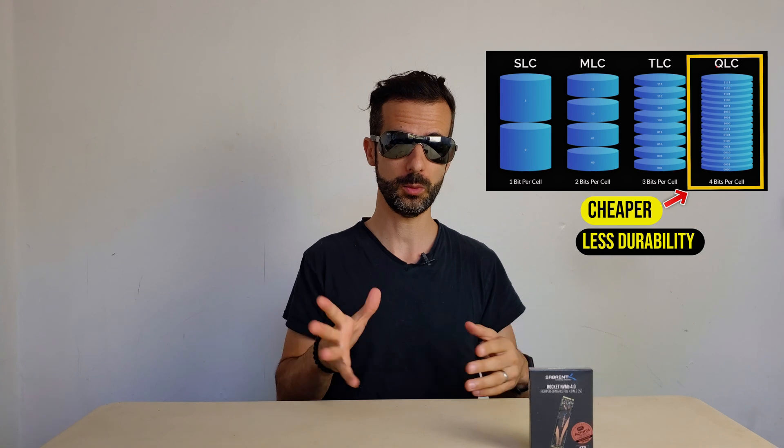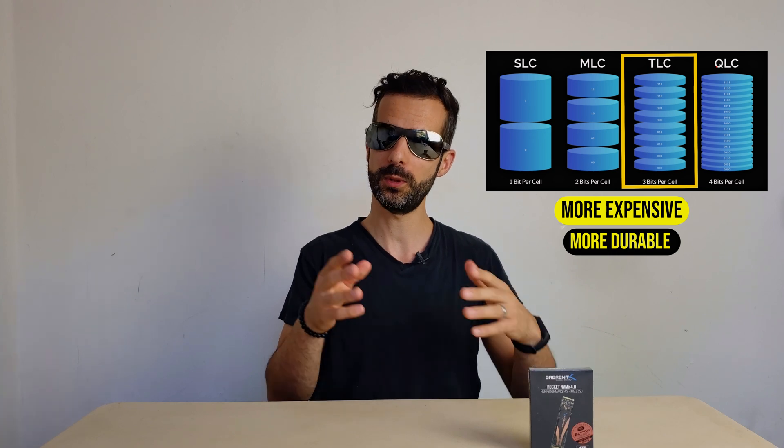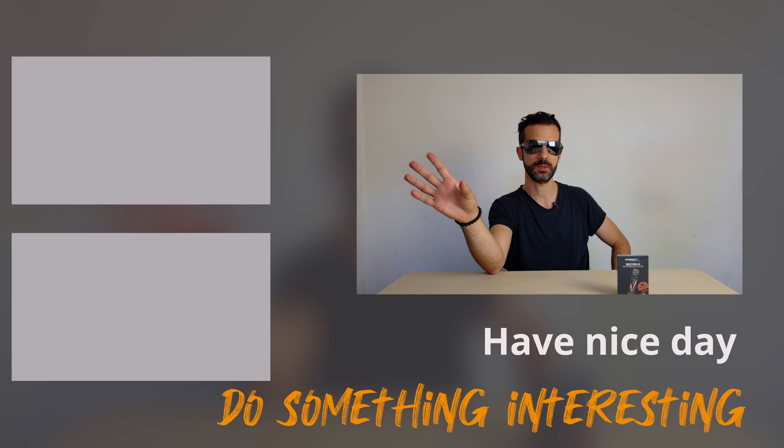So that was my adventure — that white dash in the corner of my screen. Hope this video helped you if you got problems, and helped you distinguish between SSDs and types of SSDs, and why you should use one type over another. Cheap QLC ones may be less durable, give more problems, and have more compression per cell. I had an excellent experience with Sabrent's customer support — William, you're five stars. Good brand, but still needs a bit of time to develop the product. And now my computer is working, and I was even able to update to Windows 11.